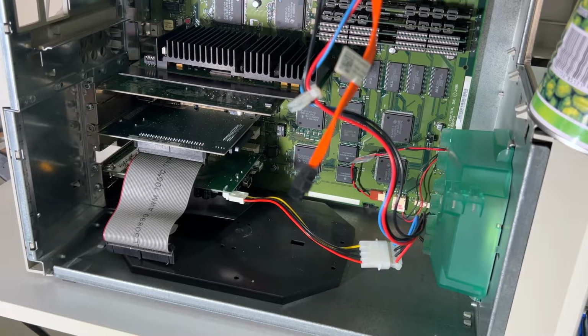The other fun issue is speculative multitasking, which I cannot pronounce that word for the life of me, so I do apologize. However, speculative multitasking is kind of bugged on the ROM of the Tsunami boards. This becomes a problem because the G3 very heavily relies on that. So you're going to get a performance hit if a fix is not implemented, and I believe the Newertech cards actually do have a fix implemented for that in hardware, if I remember correctly. Sonnet cards try to fix it in software, if I remember, and I'm not sure if the Interwear cards have a fix implemented at all.